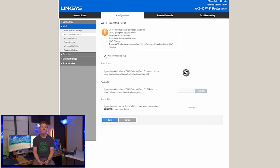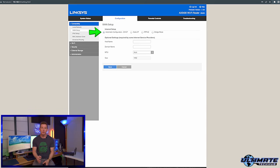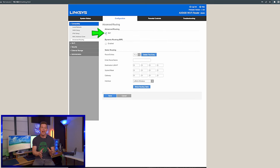Next, make sure that Wi-Fi Protected Setup is disabled — it's a big security risk. When possible, use auto-configuration tools. For instance, use auto configuration for DHCP, which automatically assigns IP addresses to all your devices. From here, also make sure that NAT — Network Address Translation — is enabled.